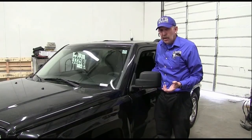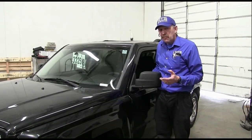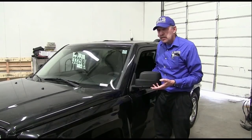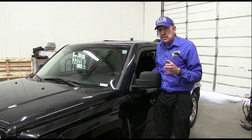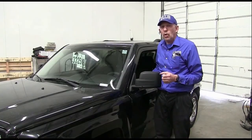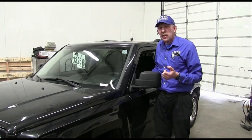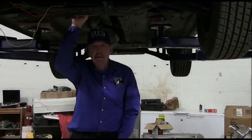And it's still broken, guys, so we have to figure out how we're going to actually diagnose these cars, not hang parts on them. So the first thing I need is a lift. Since I know the crank sensor is setting codes, I want to have my scope on the sensor connector so I can figure out what's really happening. So I need to wait here, and he's moving a car off the lift right now so I can get this up in the air and we can get a look at it.